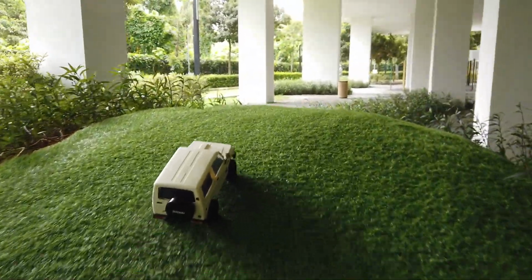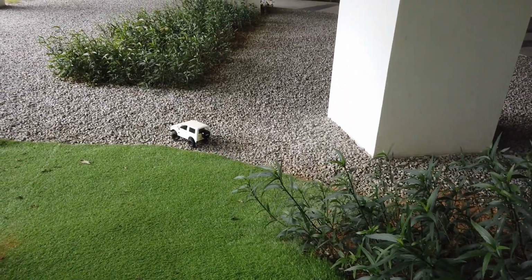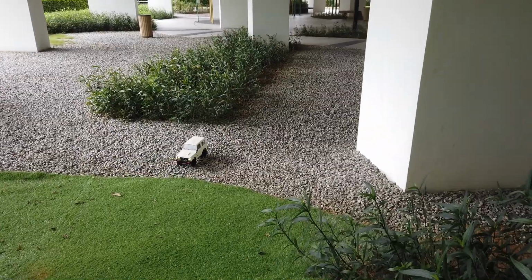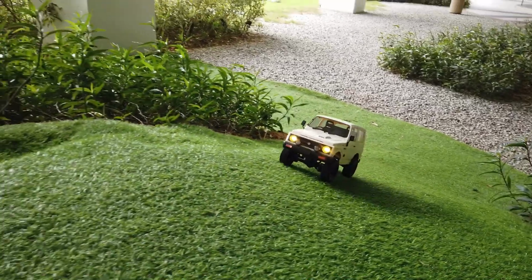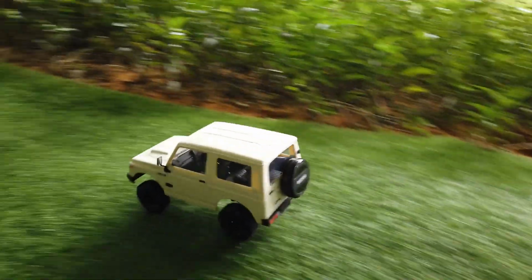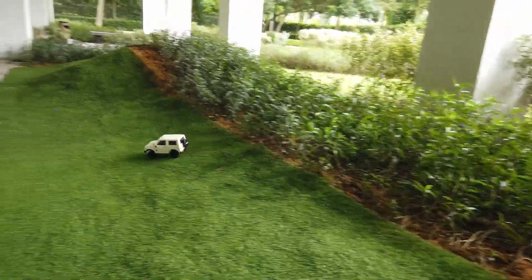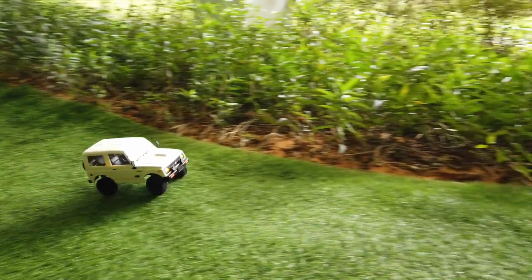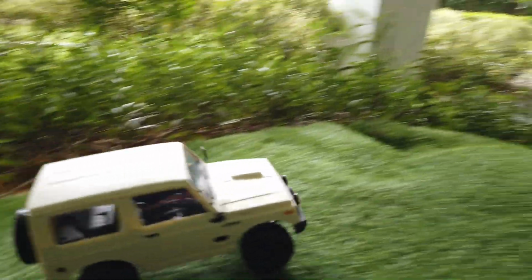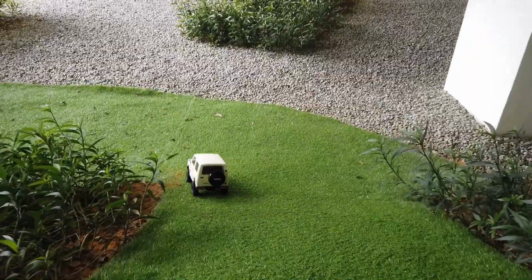There shouldn't be a problem going uphill as well, so effortlessly with the 370 motor. Oh, when it goes down, it looks like there's gear reduction, because there's just so much gear reduction for it to go off-roading or trailing. Just a nice amount of reduction, low speed gearing for off-road. So definitely going to put a 2-speed gearbox there for different kinds of driving. It's very smooth.